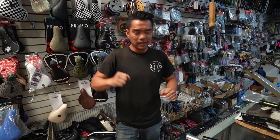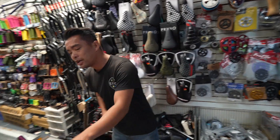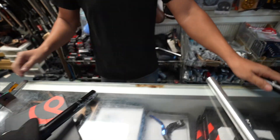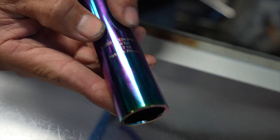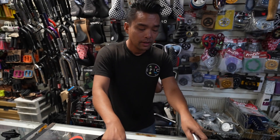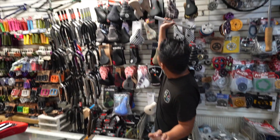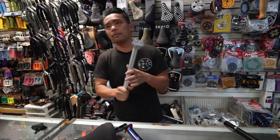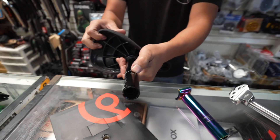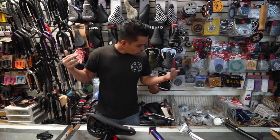Back to what I was talking about - the next thing you want to determine in our buyers guide when you want a new seat for your bike that does not come with a seat and seat post is what size seat post. If you guys look at the bottom of the post, you see the 27.2 - that tells you the diameter. Like this post right here - 25.4, that is a typical BMX size. So that's how you determine: I want a 27.2 or I want a 25.4. They all have that number. So if you guys aren't sure, bring in the seat post and go, I need one that size.